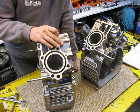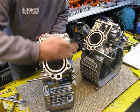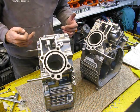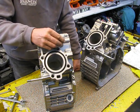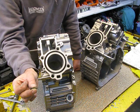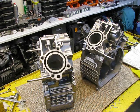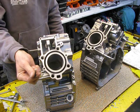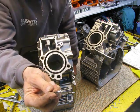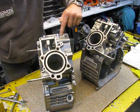When I sandblast the engine, I prefer to have these holes open so I can clean them out with air. That's what I'm going to do after grinding the surfaces off. I will get the most dirt off with the air gun. But now I have to replace the oil restrictor, and I can't get it out. So I use a wooden screw. Simple. And I need a screwdriver. That's very important to check, because it's loose already. Yeah, you have seen. Look at the dirt. I think I throw this oil restrictor away. But now you know there's dirt inside.